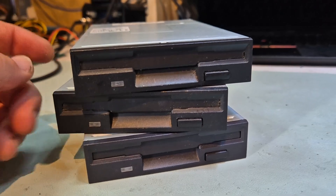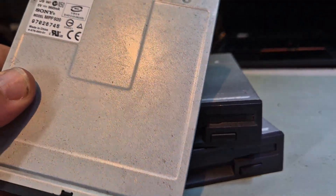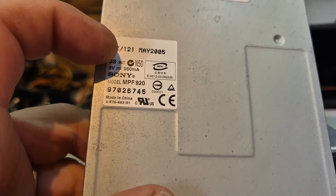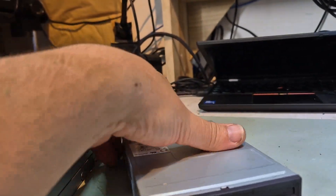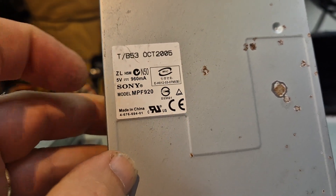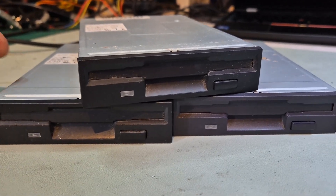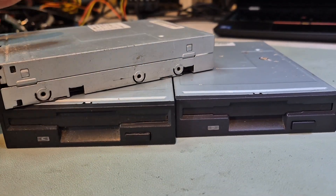There's plenty of guides available and this will be essentially just one more video on how to do this. The cool thing is these three are Sony MPF 920 — the Z121 variant. There's two of these Z121 and this one here is a B53. It's also an MPF model but they're slightly different, and a little rust on the cage here. But the good news is all of them can be easily converted to Amiga floppy drives. There's a couple of jumpers to set, I think one trace to cut and we should be good.